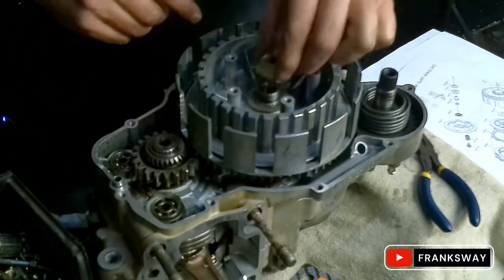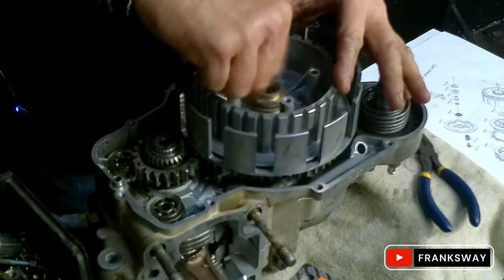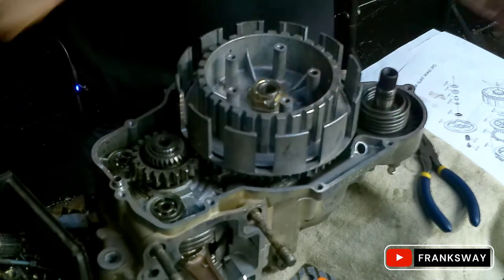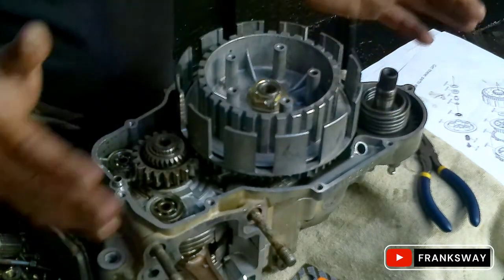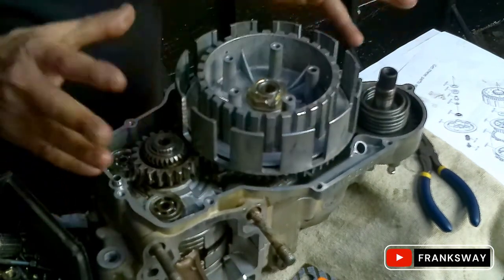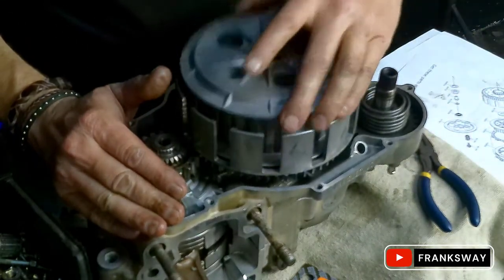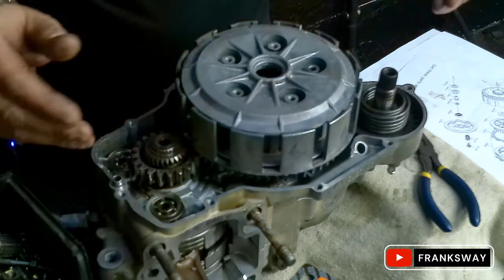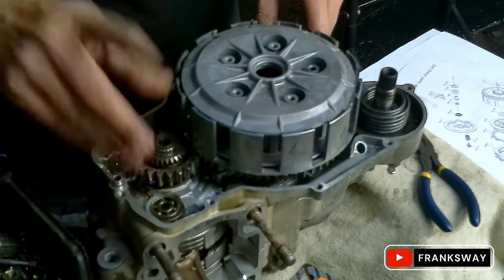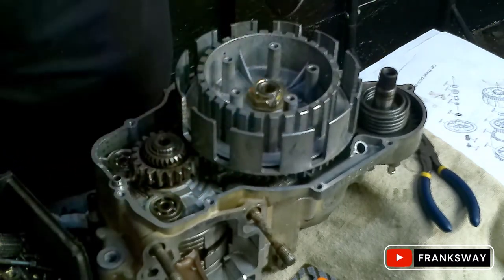All these clearances start to line up. I'll get another nut - I don't have another nut for this one - and I'll do Loctite. This is purely for instructional purposes. So this is all assembled on this side. Now we'll carry on and start doing the clutch pack. Then we'll start building the power valve in and I'll show you how we do that.